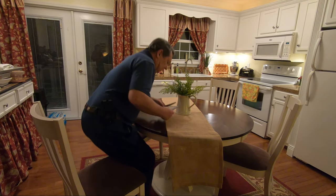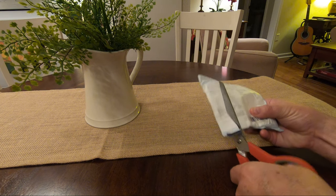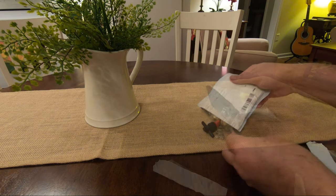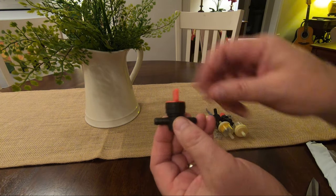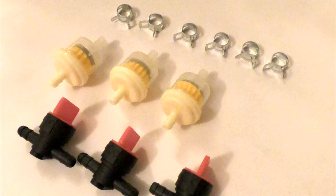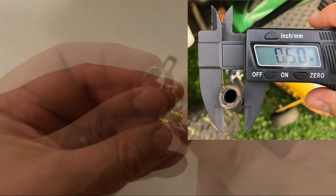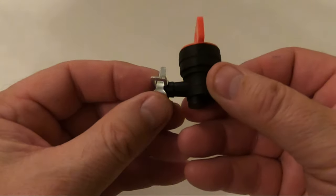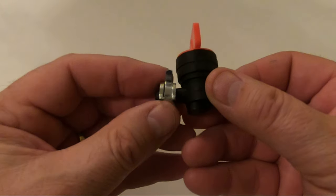I ordered this kit off eBay, and I'll post a link below in the video description if you'd like to follow suit. Since I plan on installing a shutoff on both my riding mowers, a kit containing three shutoffs was not unheard of, especially when the price includes all the clamps and three fuel filters. These quick clamps fit standard-sized fuel lines and install with only the use of some slip-joint pliers. We'll squeeze these two ears together on the clamps and slide it onto either side of the fuel shutoff tabs to secure the fuel line.